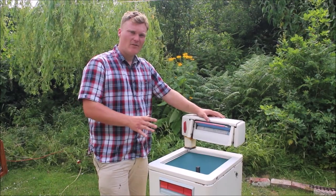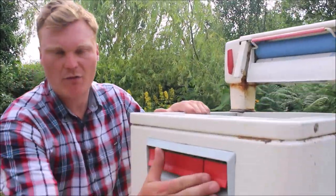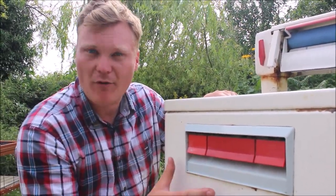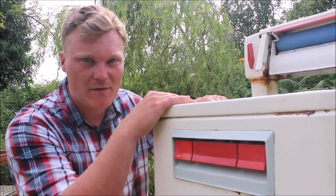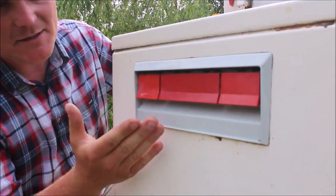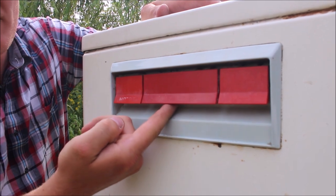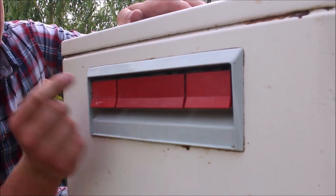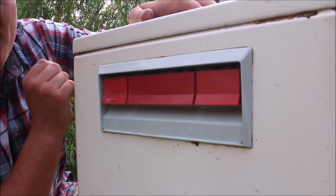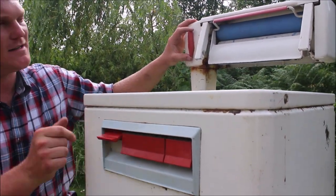Let's have a look at the very basic controls. There are four different switches. Down here we have three of them. If you have the deluxe model of the Countess there'll actually be four switches, one of which activates a heater element so you don't even need to fill it with hot water — but this more standard model has to be filled with hot water yourself. We have 'Motor', which starts the electric motor powering everything; 'Wash', which starts the agitator doing its backwards and forwards motion; and 'Pump', which activates the pump to drain the washing machine.